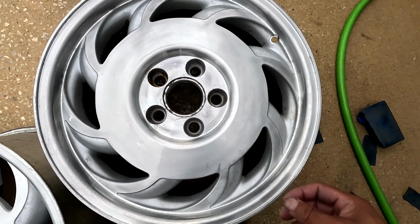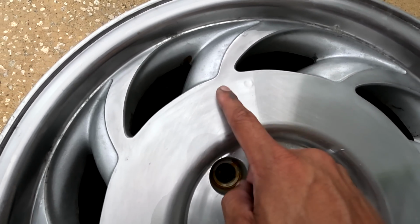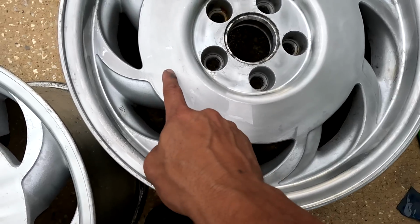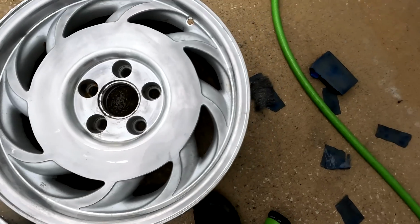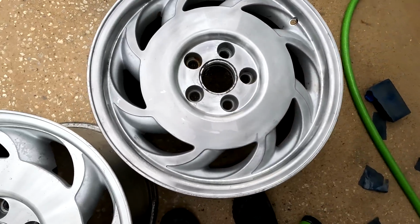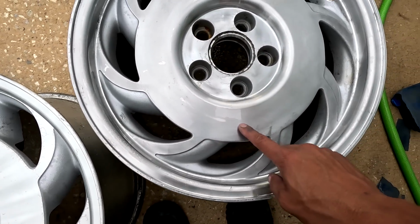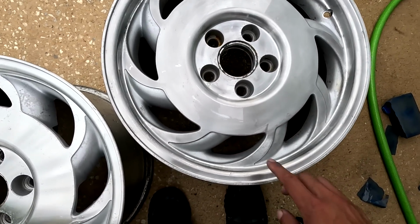It's very difficult to sand, and just the overall, you can kind of see right here, the overall finish I was getting sanding this section wasn't quite what I wanted, but the steel wool gives me that nice uniform brush look I'm looking for. So I think instead of worrying about sandpaper, I'm just gonna go through the steel wool, do the entire wheel with that, get that nice brush look all the way through, maybe do a 3000 over that, or just call it a day. I like this.